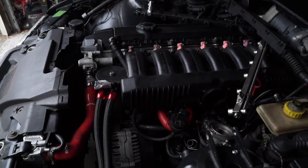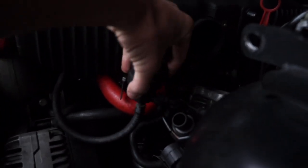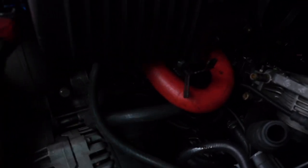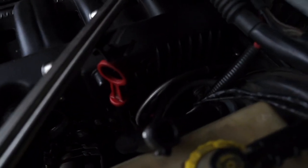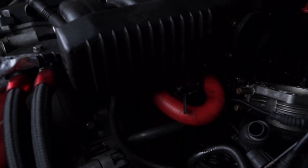After letting it air dry, we're going to start taking off the bolts that hold the manifold on. There is a 14 millimeter bolt way down there — if you trace this metal clip right here, it runs all the way down to the back towards the block where it is. It's hard to get on camera because it's so dark. On E34s with M50s there is one on the bottom of the engine block and one down here as well — E36s didn't come with the second one. Always make sure to check that that bolt is undone; if the manifold is not coming off, start looking for that second one.